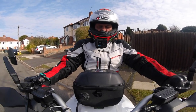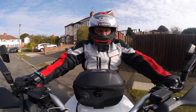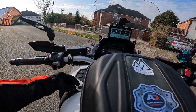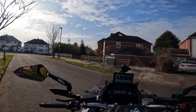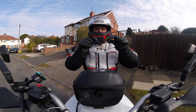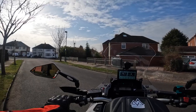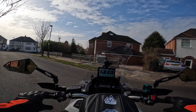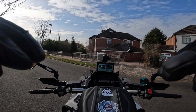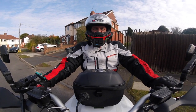So I've made the video lowering the seat. I'm now going to go and try it, but already I've noticed manoeuvring the bike, pushing it by my feet, how easy it is already. So I cut the foam to lower the seat. I also found underneath the seat there was some rubber platform feet which sit against the frame. Someone left a comment just saying they've removed those. What I've done is I've not removed them, I've just cut them down so it's not the plastic rubbing on the metal frame. It's still got the little rubber feet and it's made a massive difference.